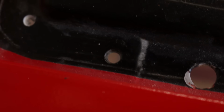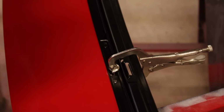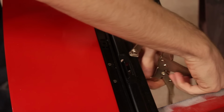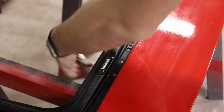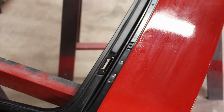And because I don't have to rivet these down just yet and can do that on the roof, I opted to wait until then when everything is where it's supposed to be for good. The only rivets that absolutely have to be installed now were the ones for these parts, which are the sunroof bracket receptacles. They naturally want to sit a little lower than where they should be, so I had to clamp these down in order to rivet them, something I couldn't do if the panel was on the car. And with all that taken care of, it's time to actually install this thing.